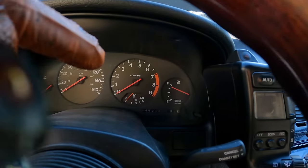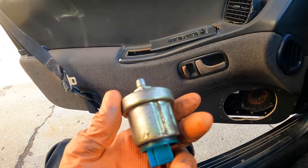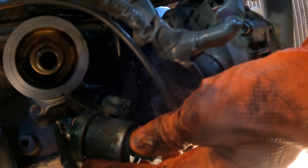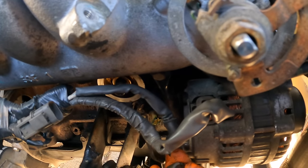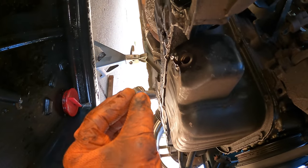I'm wondering if this oil filter housing will fit in here — it goes all the way down but it's pretty close to the oil filter already, and this one is significantly larger. I'll take off the Z32 oil pressure sensor and compare it before removing the KA sensor. The reason I'm swapping these sensors: the 300ZX utilizes an actual oil pressure gauge that fluctuates, whereas the KA pressure sensor is just a dummy light. I took off the oil filter to see better — yeah, there's no way this is fitting. I'm definitely going to need some sort of adapter. There's a brace that holds the intake manifold onto the block and it would definitely hit that. I'm thinking when I pull the KA to boost it, I will tackle the pressure sensor job then.